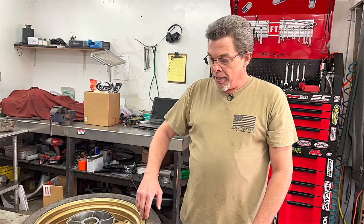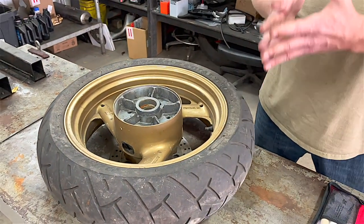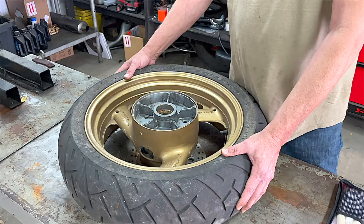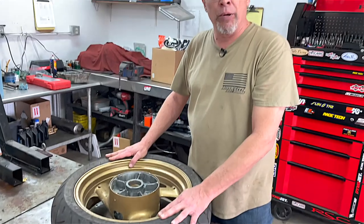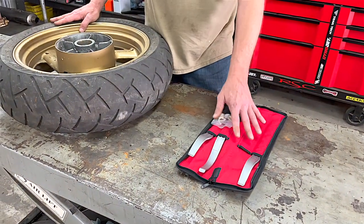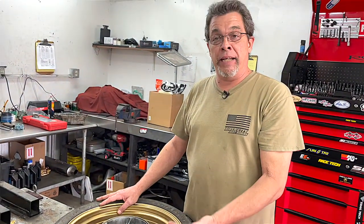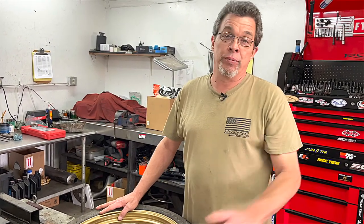One of the things we have to do to remove a tire from a rim is we have to break the bead seal. The bead seal is this edge here along the rim — that's what actually seals up and keeps the integrity and the air inside the tire and just reinforces everything. But it is a seal and it has to be broken. These are not bead breakers; they are for removing and reinstalling the tire itself. To break this bead, we have to use either a manual or a pneumatic style bead breaking machine, which we have over here in the shop.